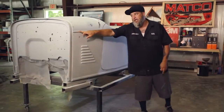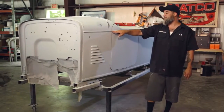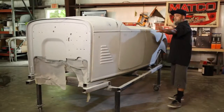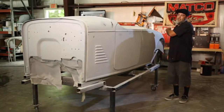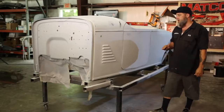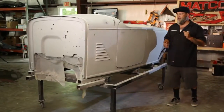This is actually a bead roll, which is a die that goes up underneath the sheet metal to create this body line. On the door here, this is actually lead, because it's aluminum — and aluminum is very fragile. When you put it on a bead roll, it'll crack and get messed up. Three quarters of the car from the bonnet back is aluminum, and the firewall and bonnet forward is all sheet metal. So you have a mixture of lead, aluminum, and sheet metal in this car.